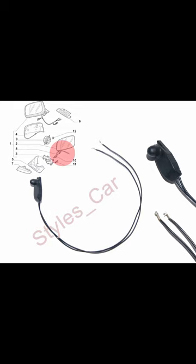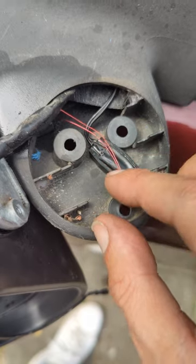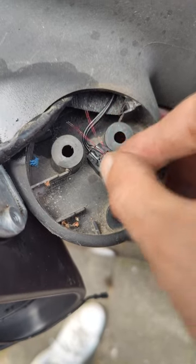If you order the original part you know how it looks, but what I ordered was something different — I ordered an NTC resistor that's basically the same value as what the car uses, but this one is meant for 3D printers. I didn't know if it would work when I ordered it, but I figured it's the same value, so it's worth a shot. I ordered about 50 of them for five euros. As you can see on this clip, the difference in size is really big, but it all went fine.